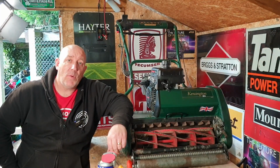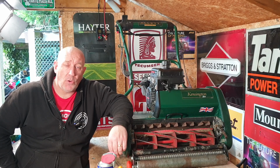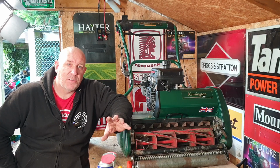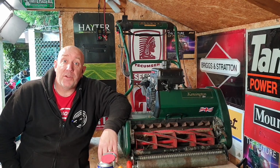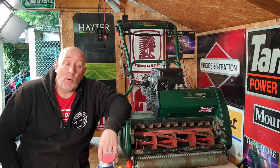Okay, so there you go. One quick video on the reasons why and how to fix if your height control is broken on your Allett or your Atco bound model. They're the 4 or 5 things that I generally look out for, and they're normally the reasons why. But the back one is the most common in my opinion, because that's the one that takes a lot of wear and tear. And those parts can be purchased relatively cheaply and replaced at home. Easy peasy, one 10mm bolt and you're away.